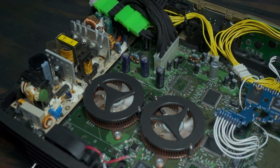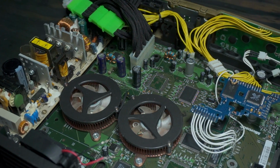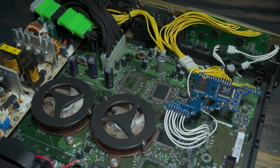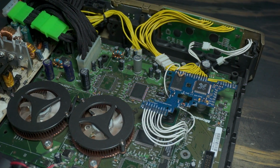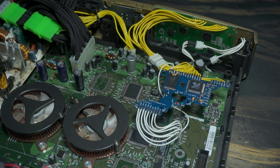so let's get this hard drive out. I took the DVD drive power cables and modified them so that I could make the LCD screen detachable from the mod chip. Turns out these cables have the perfect amount of pins for the job. You can also see the white wires and connectors. Those are for my IR and my hard drive activity light. A big thing for me when redoing this Xbox was making everything detachable, so that all the big parts could be removed in case I wanted to add more later.